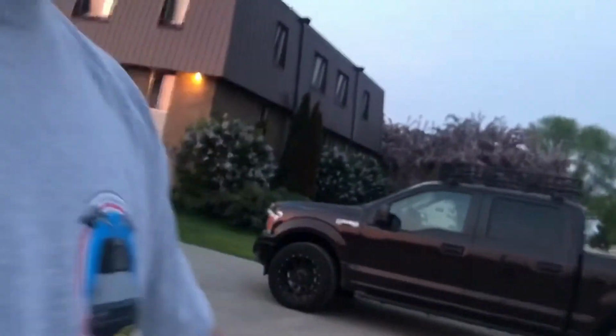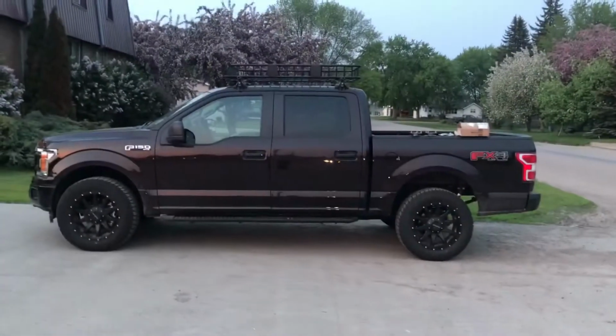And it's not factory, obviously, because there's different wheels on it, but with that being said, it changed a little bit. All I did was really change the tire size. The factory tires themselves were a 275/55, and the ones I have on there now are 275/60s. The original rim size is 20 by 8.5, so I changed that to a 20 by 9 and gave it a little bit more of an aggressive stance. And I think that looks great, but I think it needs a leveling kit.